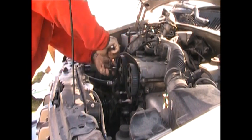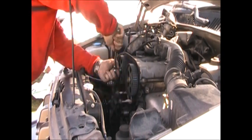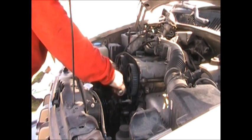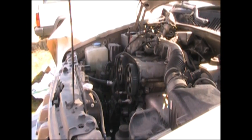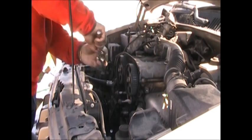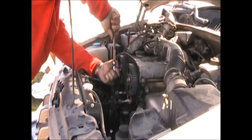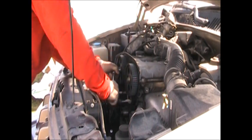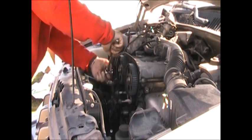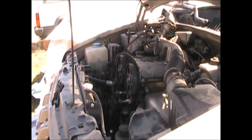I'm not getting any interference there. Of course, that could just mean the valve is already broken. It seems good. Let me rotate the crank 180 degrees and do that again. I'm not running into it — I'm not feeling any evidence of valves running into anything. So the engine may be in good shape in spite of the broken timing belt, which is good. Because there's no excuse for an interference motor — that's just bad choices.